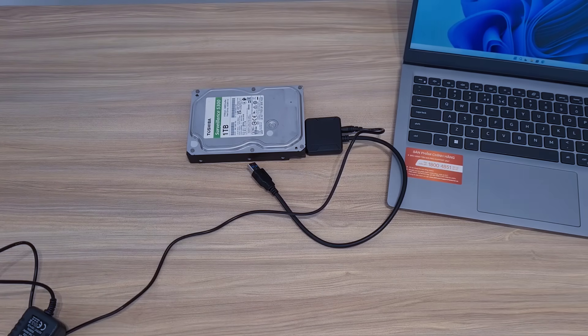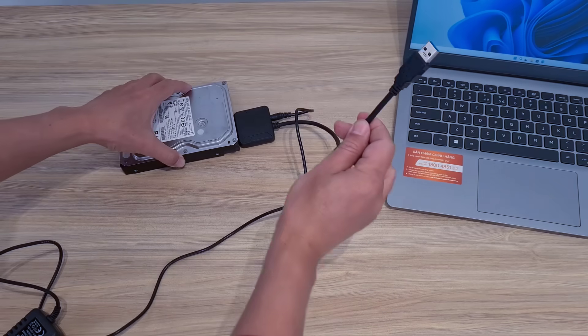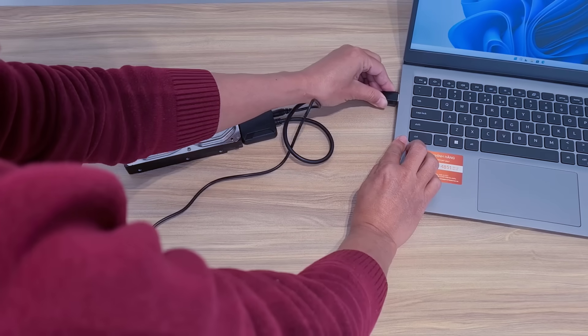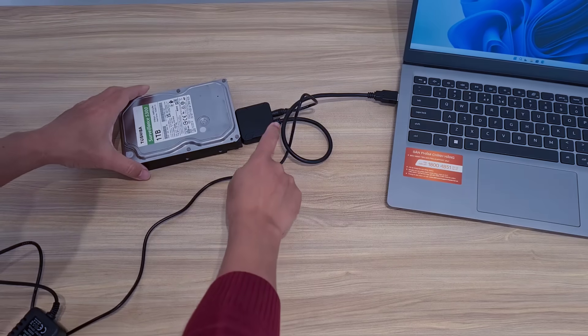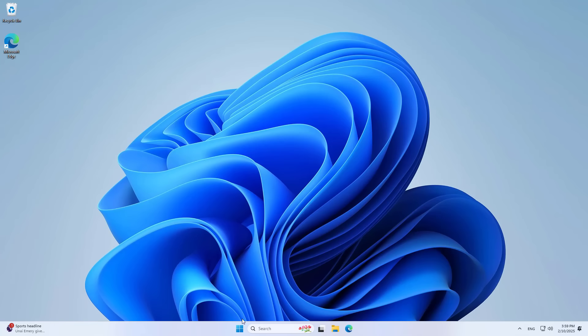You should not rush to connect the two devices together. You should connect your hard drive to a computer first — because you need to format the hard drive before connecting it to the router. I use an adapter to connect a traditional hard drive to a computer.